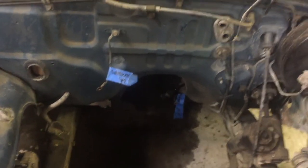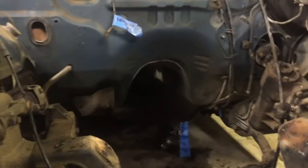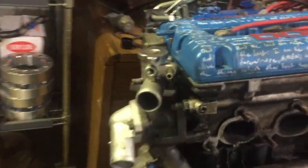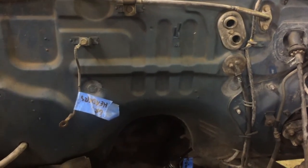I'm back at it — got the dash and all the components that would be in the way out. I'm gonna be cutting right there. I can already tell by looking at the engine and transmission that the other engine didn't have all this back here — it just went straight up. You can tell from the slope of the transmission and the way the transmission tunnel is shaped that this right here is gonna be in the way. I'm going to do some measuring and cut something like this to make room for the water outlets. Once it's cut out I'll set the engine in, line up some mounts, make sure the transmission mounts right, and then weld the firewall back further using some extra metal I've got.